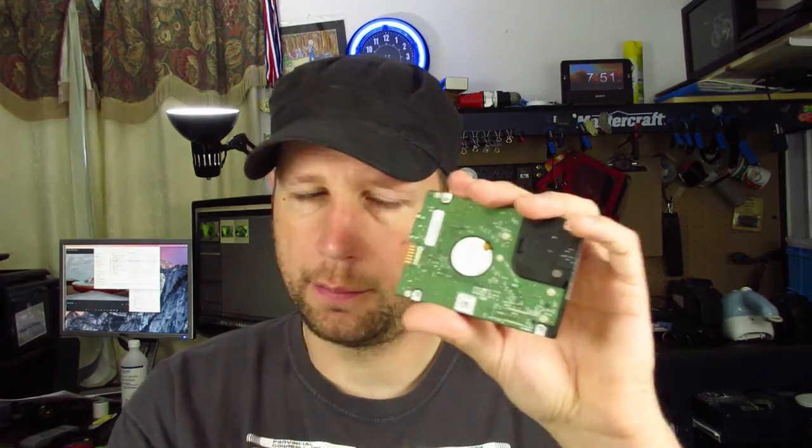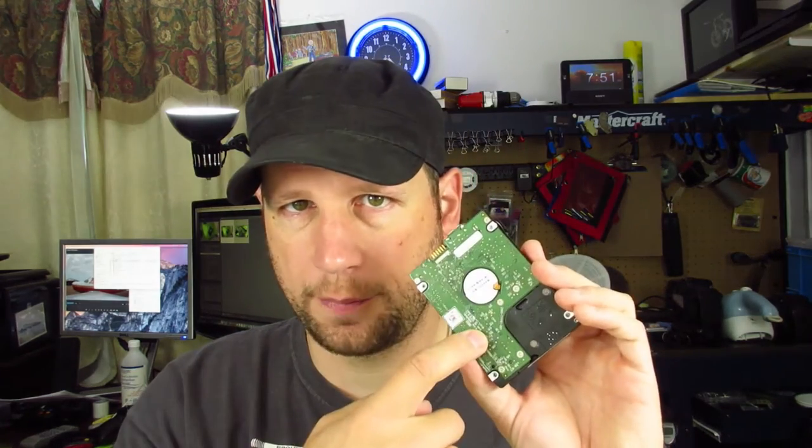If you have a hard drive where the board is dead — not physical damage to the disks themselves or the motor that spins the drive, just that green board — you might have some luck replacing it by contacting Dataprolab or wherever is closer. This place is in White Rock, British Columbia. Depending where you are in the world, it could be expensive to get there — it even cost a fair amount to ship from the east coast to the west coast of Canada, and it took 14 days. To recap: the green board comes off, you send it to Dataprolab, they take the chip off the old board, put it on a new board, and send it back. Super easy.